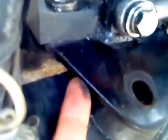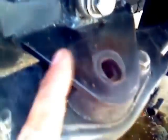These two bolts feel like they have a nut on the bottom. This is called the dog bone — it centers the motor for alignment. Everything I've seen says leave that alone, don't loosen any of those bolts. But the bolts behind it in the back — one here, one over there — we can loosen those. That'll loosen this black main plate enough so that if we need more play to lift the motor and swap the mount, we can. Those bolts have their own nuts on the bottom to be aware of.